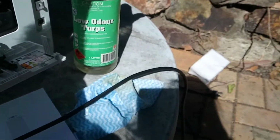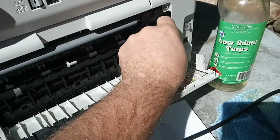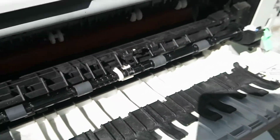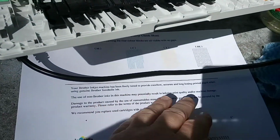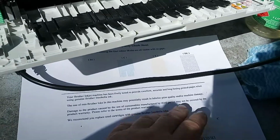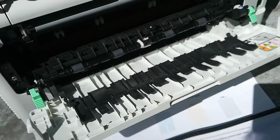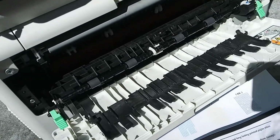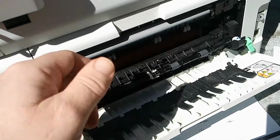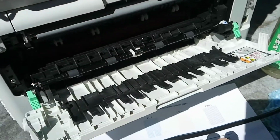That's preferred because that dissolves all oil-based contaminants on the actual rubber rollers. So on these rubber rollers, what happens is the paper isn't a perfect product, it comes from trees, usually like pine chips, and they're heavy on pine oil. So as the paper's coming out and the paper is being heated to 200 degrees Celsius, in areas that have really high moisture in the air, you'll notice on cold days that the machine is producing steam, and in the steam there's also oil vapor from the tree pulp.